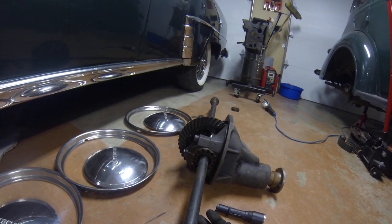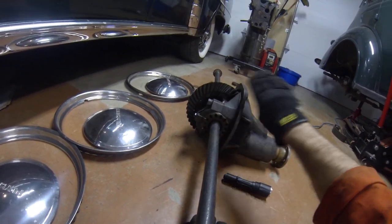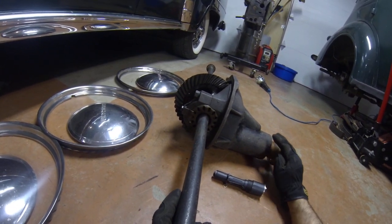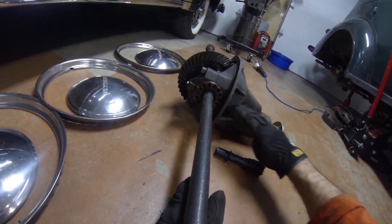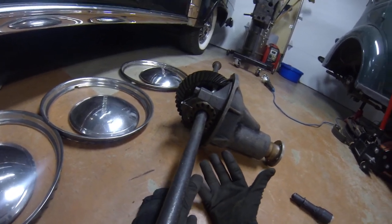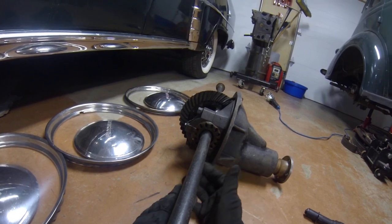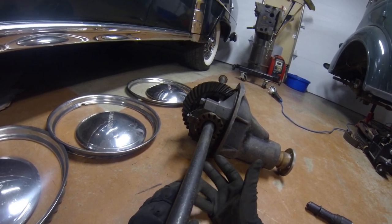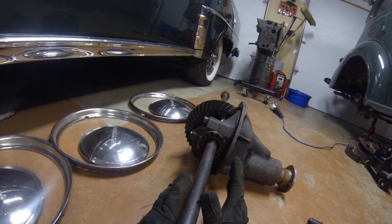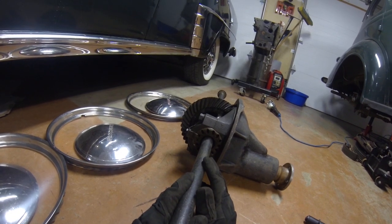There are a couple of reasons for that. We're making use of spiral cut gears — these gears have to be cut on a spiral pattern. The reason is we're not at 90 degrees; if the pinion was at 90 degrees right at the center, they'd be cut straight. Moving them down gives us spiral cut gears that run quieter. You always have at least two pinion teeth matched with the crown gear, which gives more strength and spreads the gear load over a wider surface.